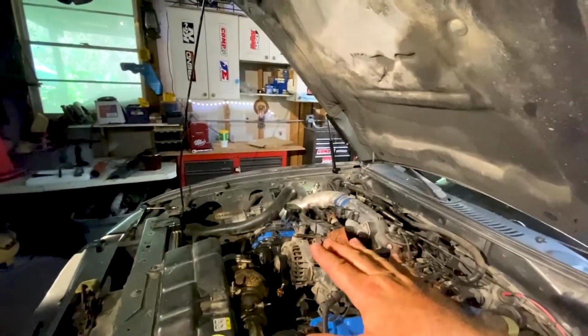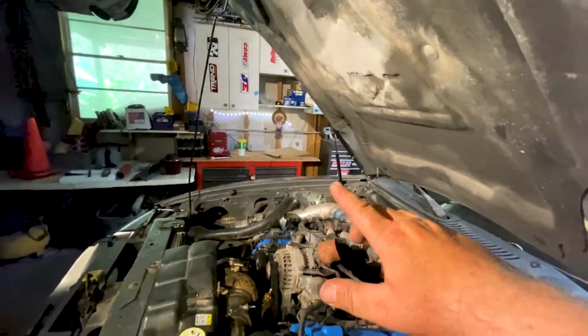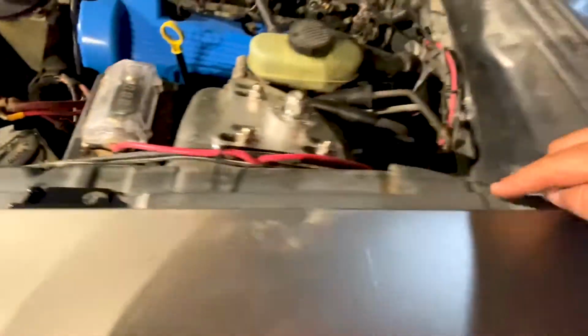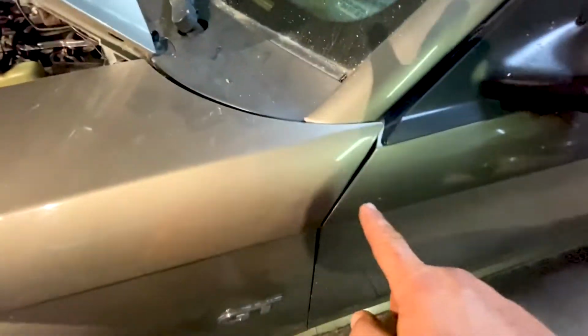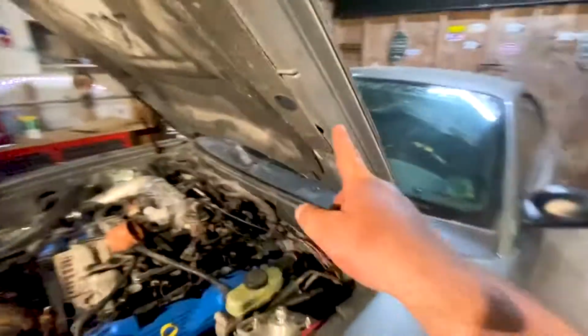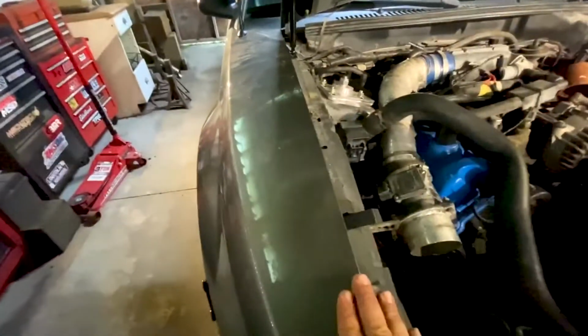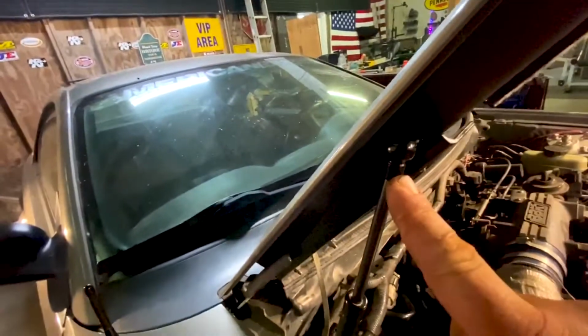When you bring the hood down, make sure that your alignment is right, that you don't scratch this when it comes down. After that, since you do loosen your fender bolts, loosen one at a time, since you don't really need to loosen that one. Watch your body gaps, check your hood gap, adjust your fender and hood as needed. Most likely you should just need to adjust your hood, because you don't really take any bolt out except the one down here. I showed you the trick with the clips to get them in.